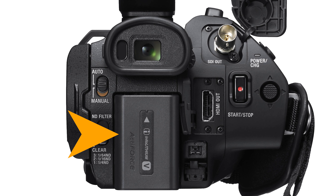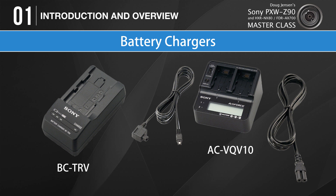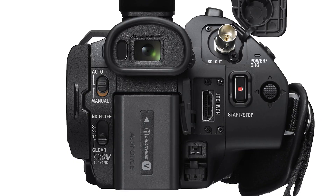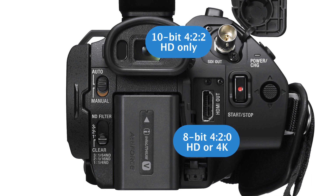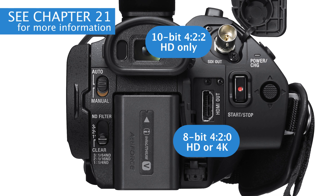Next we come to the battery slot. Unfortunately, the battery release switch is located under the camera, which I think is a terrible location — every time I change batteries, I have to take the whole camera off the tripod. If there was just one thing I could change about the camera, this would be it. The camera comes with one NP-FV70A battery that will only run the camera for a little over an hour, so you'll definitely want to invest in extra batteries and probably a standalone battery charger. The camera doesn't come with a charger, so the only way to charge is by plugging into the included AC adapter, which obviously ties up the camera. Just above the DC-in jack is the HDMI out jack — all three cameras have the same HDMI port, but only the Z90 also has an SDI out jack providing a 10-bit 4:2:2 1080p signal with two channels of embedded audio and timecode.